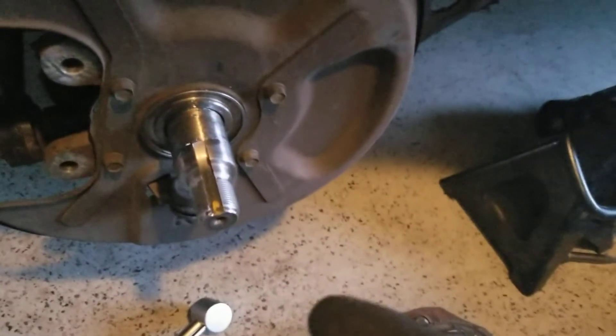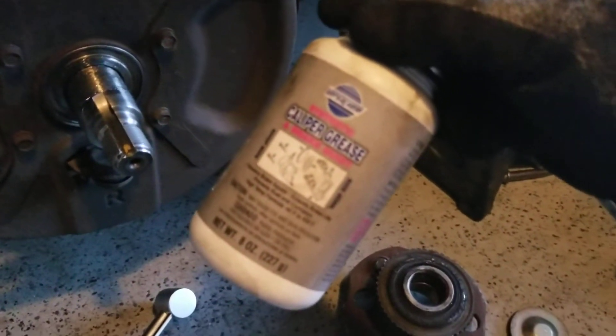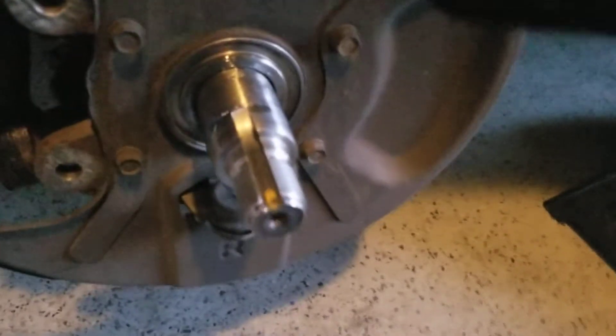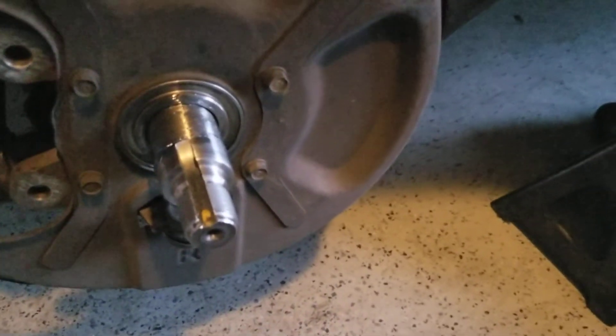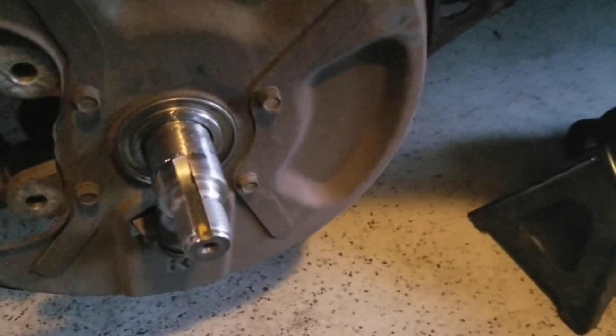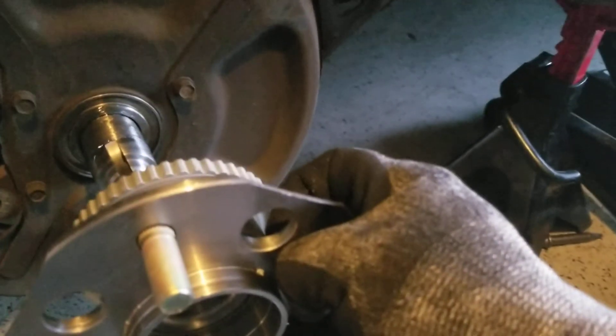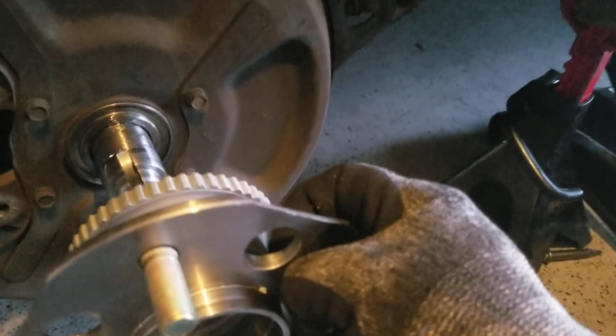I checked out the surface and added some caliper grease and synthetic grease — I've used it before on other stuff and it works pretty good. This vehicle has 110,000 miles on it, so I'm pretty sure that's the original hub assembly. I'm going to install the new one — I believe it's torqued down to 133 or 136 pounds; I'll add the exact torque spec in the description once I verify it. Hope this helps.